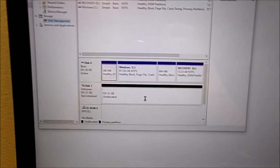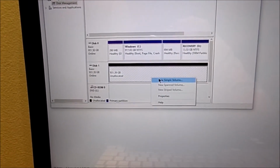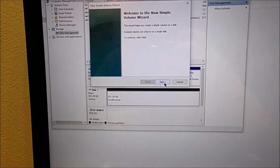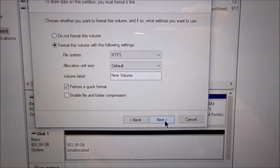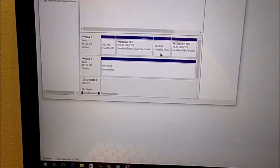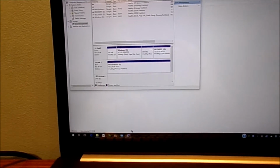What's that going to do? It's going to initialize the drive. And what we're going to do next, you want to right click it. Put a new partition on it. Hit next. Okay. You can name it whatever you want. Just showing you how easy this is. Now once it's formatting, you're going to get access to the drive. And there you go. Let's go back to My Computer